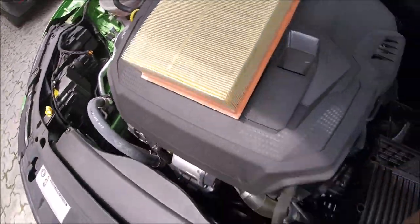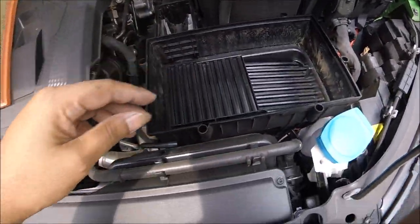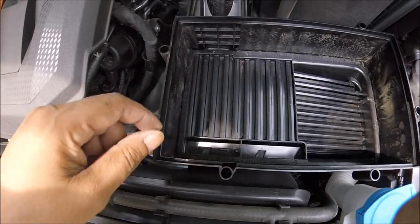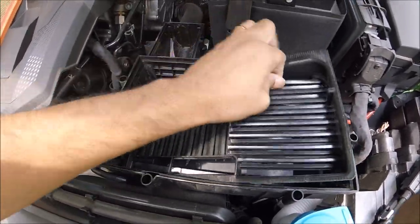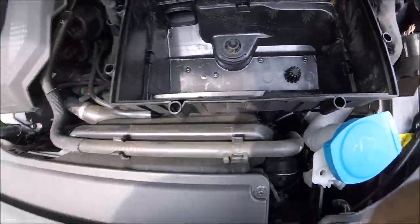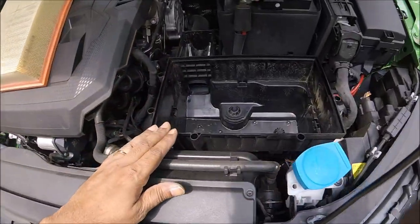You can already see how much stuff is being sucked in. This is your intake grate — it's called a snow grate. It's supposed to prevent snow that comes in from your intake side from getting stuck in the intake. You can see how restrictive it is. In India we don't get snow, so we should be able to do without it. Removing it should really improve the flow of the intake — this is a very restrictive system. To remove it you just pull it off, as simple as that. So that's the snow grate. Removing this should give you a lot more airflow. You can see the airbox over here — it already has a drain which if you accidentally suck in water, it will accumulate there and go down, not into the intake. This is all closed up.